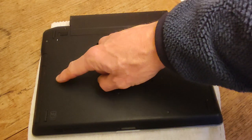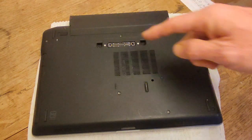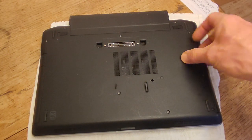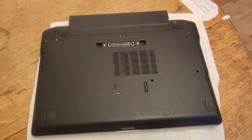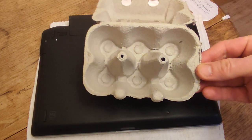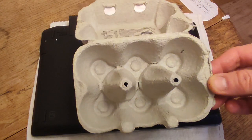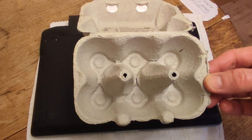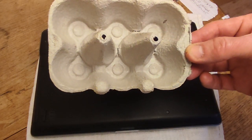Then we're going to need to take out the DVD drive which is here on this edge where my finger is. And then we need to take off this plastic case. Because there are going to be quite a few screws, what I would suggest is something like an egg box, so that you can separate the different size screws out. If you're more organised at this stage then when it comes to putting everything back it will be a far quicker and far less painful process.